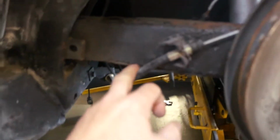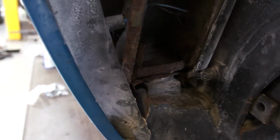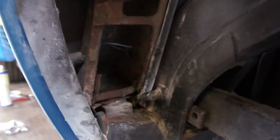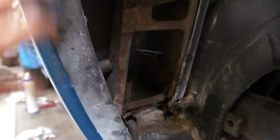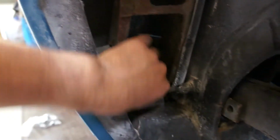And you know, on this side that bumper hole isn't very nice. This side is the worst. There's some damage on the trailing arm here where it's kind of split apart a little bit, and it's in this trailing arm, this number 3 body mount, that is showing the most signs of rot. So we've cut the fiberglass panel off just to give us a bit easier access in there, and I've ordered a new one for this. And this will need some quite extensive repair.